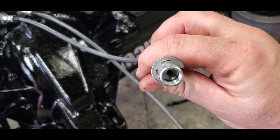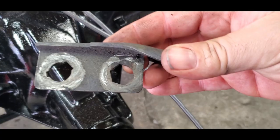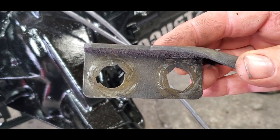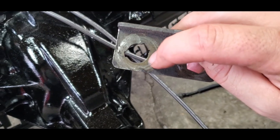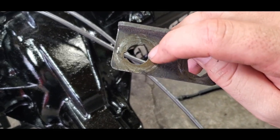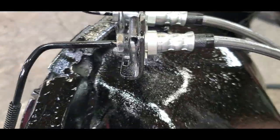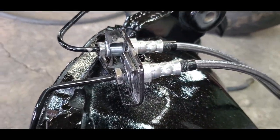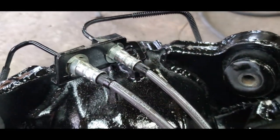See, there are the ends I'm talking about. This one does fit — that one right there by my finger. The second one, we're still working on it. They have one that fits pretty close, but it's a mirror image. I just drilled that out with a unibit, basically brought it up to the edges, and it fit perfectly. You really can't tell. It still has the factory clips on it. Totally should have put all that on before I painted the rear end, but it is what it is. They fit, they bolt up good, they're snug — they don't flop around.